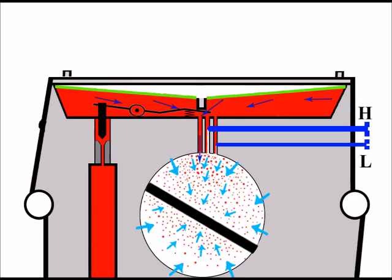And when fuel is used out of the fuel reservoir beneath it, it draws the diaphragm down, as you can see there. And when it draws the diaphragm down, it allows more fuel to come through into that reservoir area. And the reason it can flow through freely now is because that needle valve is now off its seat, because the metering diaphragm has pressed down on the lever, allowing it to be lifted off.